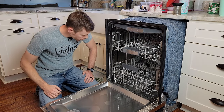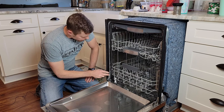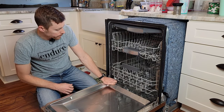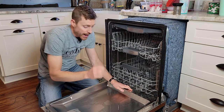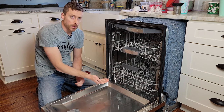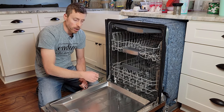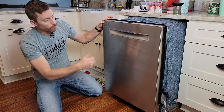What I did — and this is what you should try before pulling your dishwasher apart, you can even try it before pulling it out from under the cabinet — is thoroughly clean all of the gaskets around the side. The most important one is the rubber gasket on the bottom side of the door, back in there where you can feel it when you reach inside. Mine had a whole bunch of gunk stuck in it, and I believe that's where water was getting through and tripping the E15 error. I took a toothbrush, some cleaner, sprayed it in there, scrubbed it well, and used paper towels to get all of that gunk out. You need to make sure your dishwasher is sealing tight before it runs.